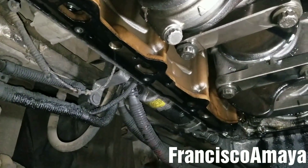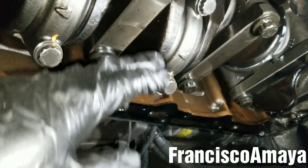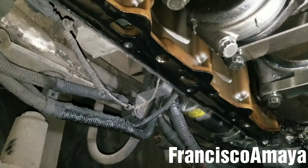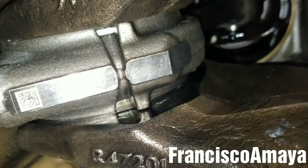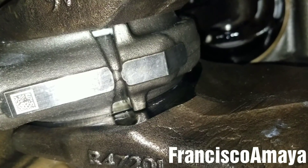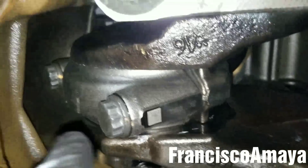After replacing the caps, you have to rotate the engine and make sure it rotates freely with no effort at all. Another thing is to make sure the caps over here are completely sealed. If you see them open, there is something wrong — maybe they're backwards or you didn't start it properly. Make sure the arrow is pointing to the front on all of them.